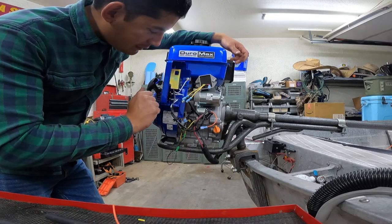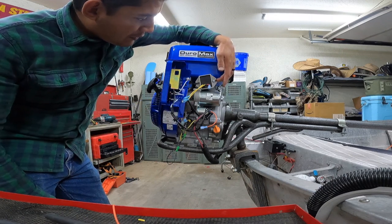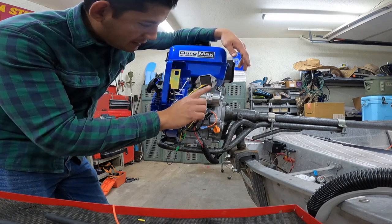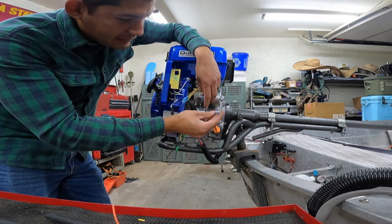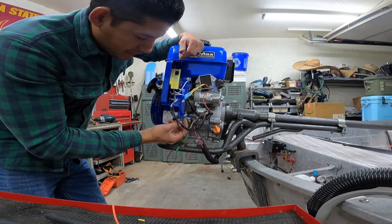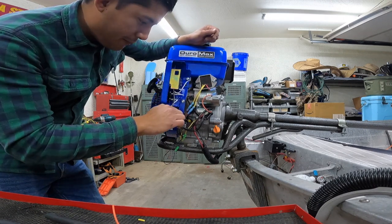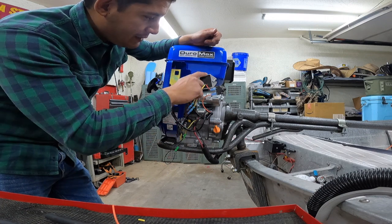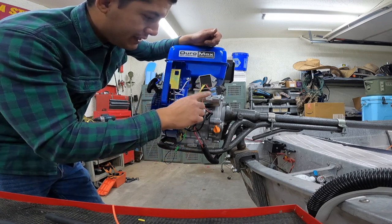Off camera I did the mounting — put spade connectors on the AC input to the rectifier, and used a mounting bolt grounded to chassis to hold it in place. This is our DC positive out. I have a 10-amp circuit breaker in-line for this test, and the charge goes straight back to the battery. The two AC outputs from the coil stator connect to the voltage regulator; AC voltage could be up to 45 volts AC, but the regulator will output around 13.5 volts DC.